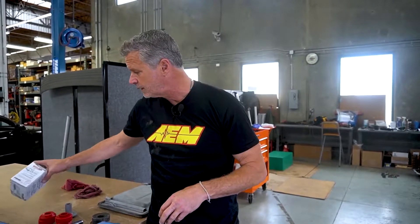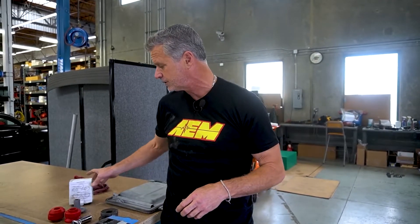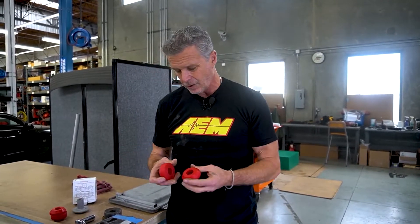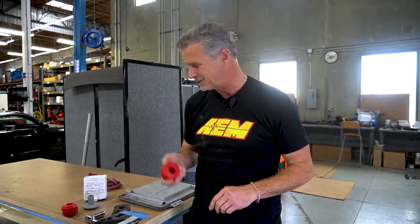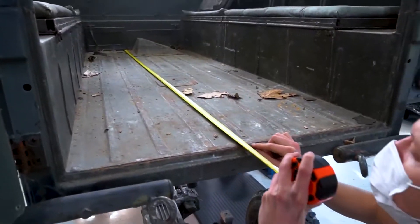In addition to that, with the body lift, the mounts that were inside are pretty hammered — I mean, they're old, 1971, right? The other challenge with something old and limited in production like that is the cost. These pieces are about $80 for one from a good Pinzgauer supplier. We were lucky — I talked to a few people and the guy said go to Prothane, they've got a bunch of universal bushings, and lo and behold we came up with a bushing set that's almost perfectly sized for the factory chassis mounts. A full set is about $20 — an awesome find.